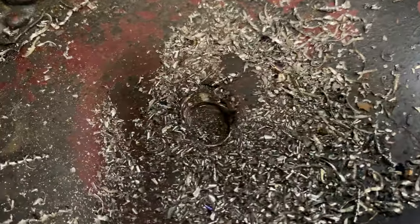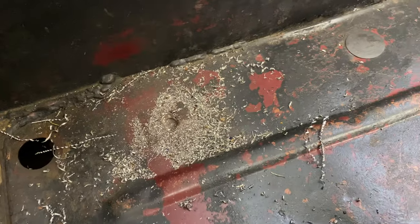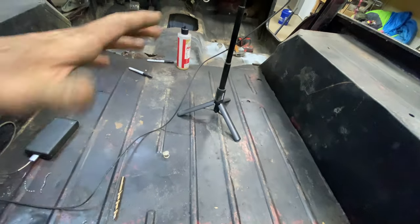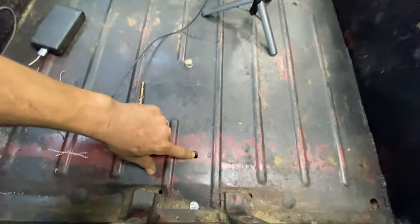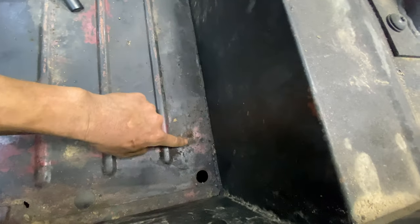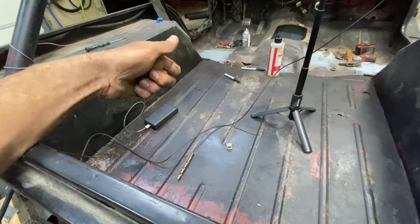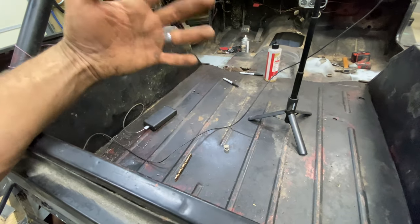I was trying to extract some of the broken rear seat bolt holes — totally nasty. I broke off my easy-out in there. I've got about five or six total and they are so shot. I think I might just slice them from underneath and try to break them off with some pliers, then weld in some new nuts.